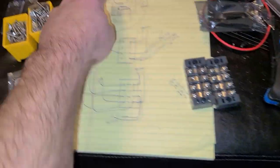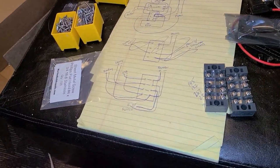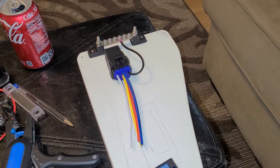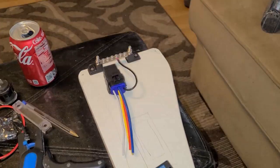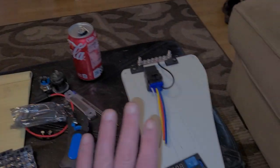Here's my mess in the living room. Why am I in the living room? It's really cold outside and I don't want to go out there with all this electrical. Here's my main scheme, and here's a secondary one — this one really focuses on the toilet, the pump and the timer, and this is more the lights. I've got to check and recheck it because we only want to do it once. I'm going to have this board installed so that if I really needed to get into all of this and replace things or diagnose it, I don't have to do it in a locker.